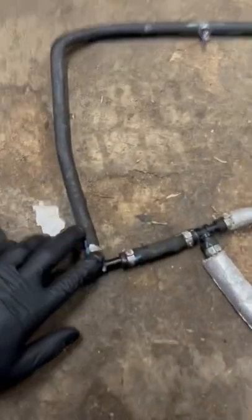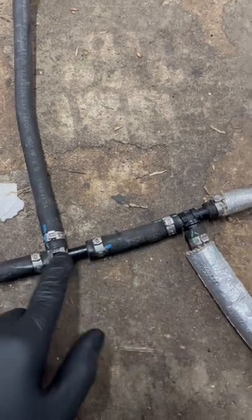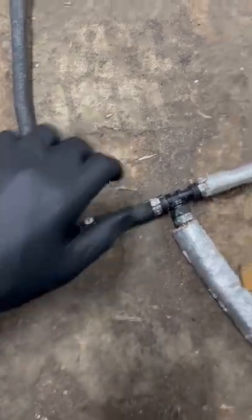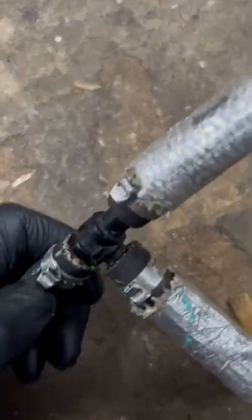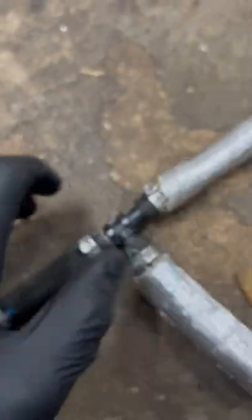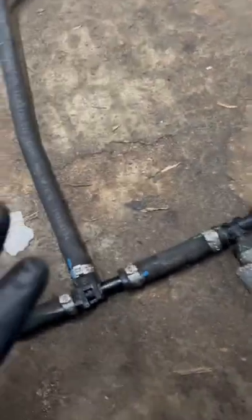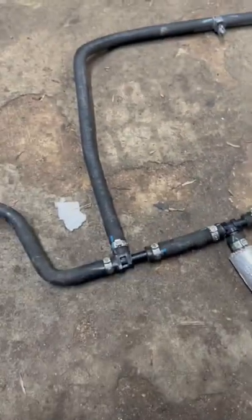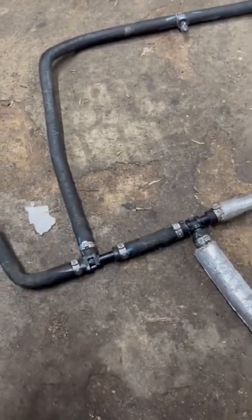Here's the old one on the ground, and on this one it actually pushed the hose off of this little T-connector where this crimp goes down. A lot of times I don't see it push it off — what I see is what looks like these little eye boogers coming outside. You can see it a little bit, but they'll be much worse on some of them. It'll have caked up all around the hose, and that is actually coolant leaking. What will happen over time is it will blow the hose off, crack it, or leak all your cooling out on the ground.